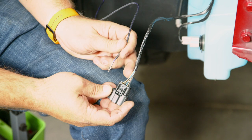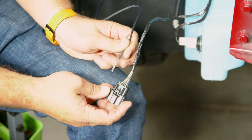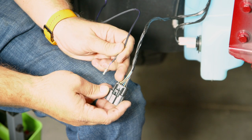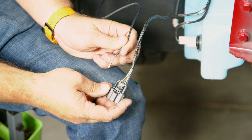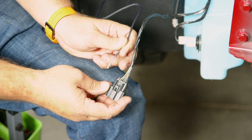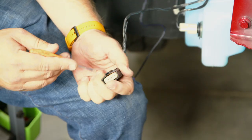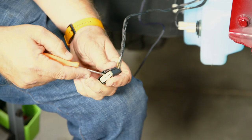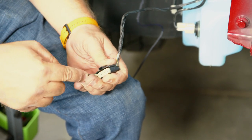Now the additional wire is gonna go in the unused slot inside your fog light marker light plug. Now there's two ways you're gonna have it. You either have this little white stud in here, which can be removed, or there's gonna be a little black blockout plate that you'll have to actually grab a small pair of pliers and bump out. But either way, to get to that, you start by pulling off this cover here. To remove this, basically, let's get a little small screwdriver, just get back in here, and you can pop it out.